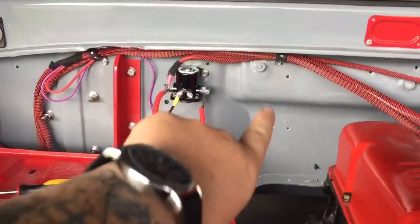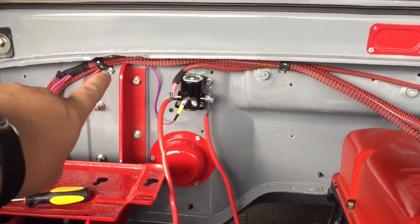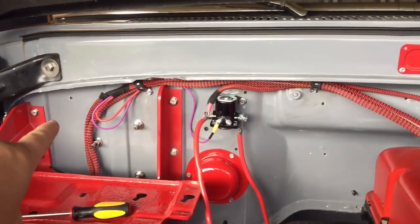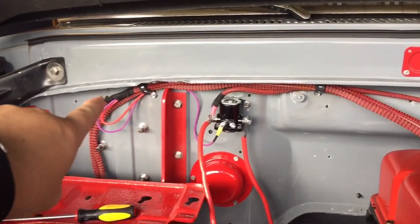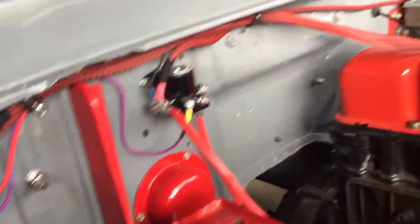Overall, what I've got going is I got everything all wired up. That red line comes back out of the main harness from the panel, and it goes to that little black wire which is a fusible link, so they're connected. Obviously these are going to go down to the battery and the alternator, runs underneath here, goes up to the horn. I only got one horn — there should be two. Runs up to the headlight, got them on both sides.